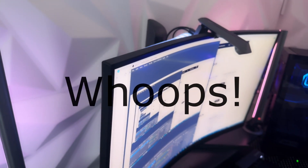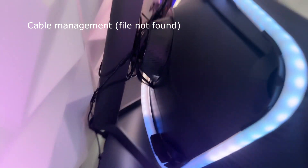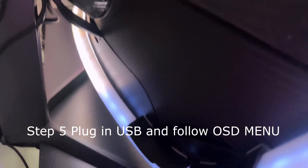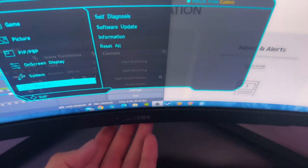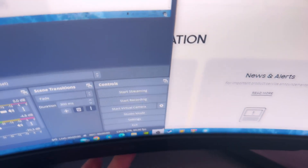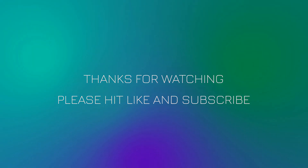I was going to update the firmware as planned here, but I've got this mad RGB setup at the back which is covering the panel where you plug in the USB. I'm not going to do it on this video, but there are USB ports underneath — plug it in, then go to the OSD menu, Support, Software Update. As soon as you hit that with the USB in, it'll launch straight into it, or it'll ask you if you want to go ahead. Say yes and that'll be your firmware update. As long as you don't have a power cut, you'll have no issues. Stay tuned guys, there will be more videos coming — I'll see you next time.